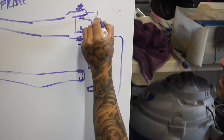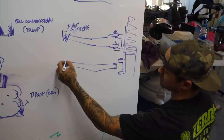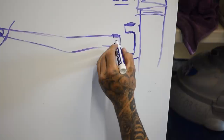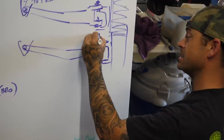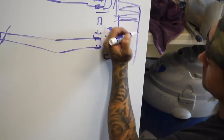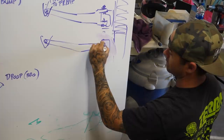With a kingpin, you have your beam that goes through the pivot. Again, it's looking from the front of the truck, and this is only the driver's side. So your beam would be mounted to your frame, and then it would go out, and on the end you would have a female hole where the kingpin is the male piece that goes into there. Once that's in, this spindle would go over like that, that's your spindle, and then your kingpin would go in there and hold these two items on.